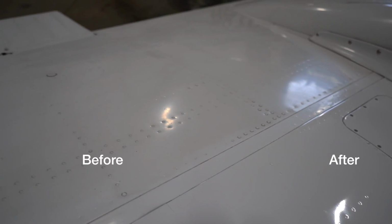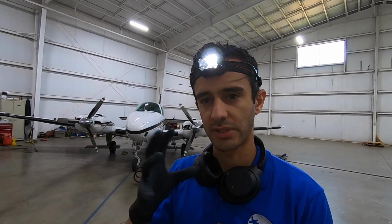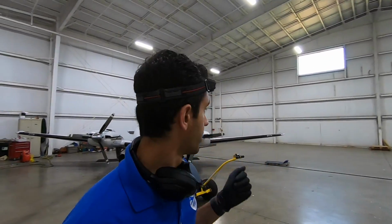It has a lot of oxidation and the paint is super porous. So as you remove the oxidation and that paint residue, it just gets sucked right back into the paint. So it forms these clay-like complexes. It's really important to keep clean pads and work small areas, which means it just takes a longer time.